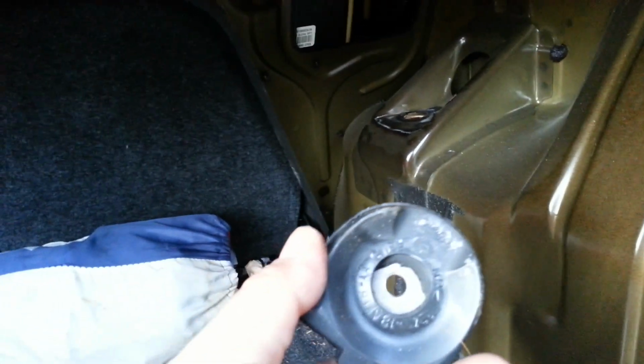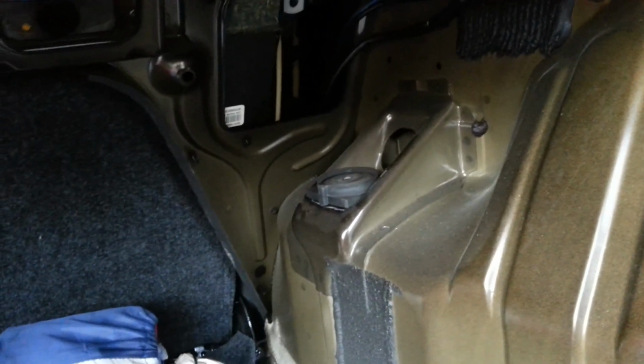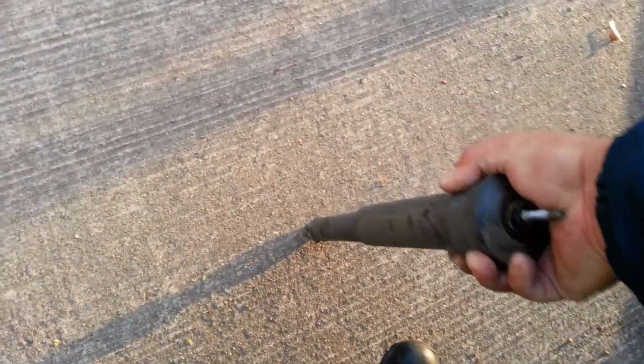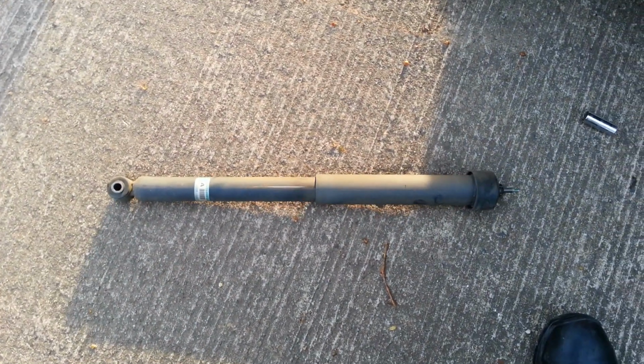Once you pull the nut off, the nut comes off the top, the shock's gonna fall. And then there's this piece on top, which is a washer bushing all in one. That'll just stay on top of there, no big deal. When you put the shock back up through there, that's what you're gonna center it with up there on top. Out here, get that nut off, and it's just gonna fall out. So then you grab your shock. There's the old one. Now, they tell you that if these don't pop back up, that they're bad. This one is still good.